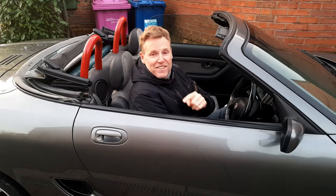Not quite moving yet — got a flat battery again, so I think I need a new battery. Clutch is done. This video is all over the place — I'm jumping between clutch and brakes in reality but I'm covering clutch first, then brakes. I lost a fair bit of video footage for the brake stuff. In terms of the brakes, this is all about the rear brakes — the whole line from the front of the car to the back to the three-way union in the engine bay on the firewall, then going up to each of the rear wheels. I also did the flexis as well. All the parts were corroded.